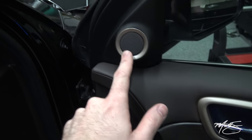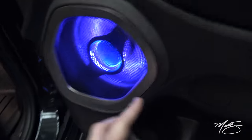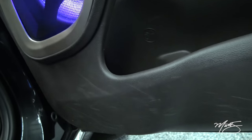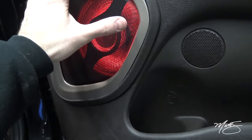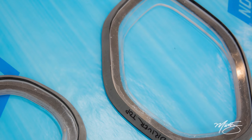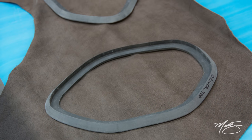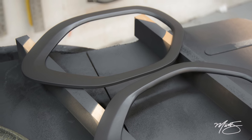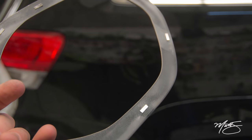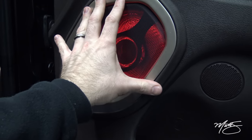The gold was paint matched to all the other trim on the vehicle to match the OEM trim color. This is a piece of PVC — that's how the trim is made: a piece of PVC, chamfered on the edge, with a rabbet on the inside deep enough to hold the trim. On the back of this trim we have magnets which magnetize to the grille and hold the trim on. That's how this piece is engineered.